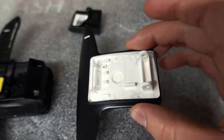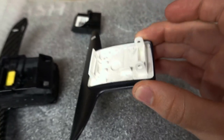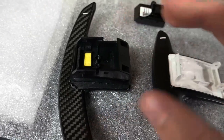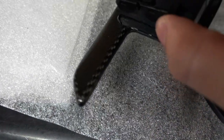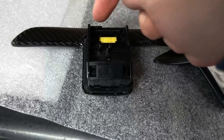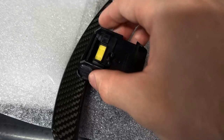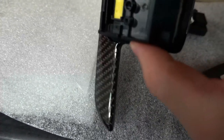Here is the underside of the paddle. They did a pretty good job of mimicking it — you can see how the pin slides through those two holes and how everything aligns. The spring sits in that little circle. I went ahead and greased the spots that were greased on the OEM one so everything is well lubricated and hopefully functions like OEM. The one problem I had on this paddle shifter: there was some rubbing on either side of the plastic OEM assembly, so I had to file down the edges right there. That allows it to not stick. I think I got everything actuating like I want it.